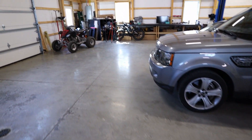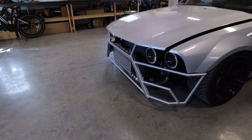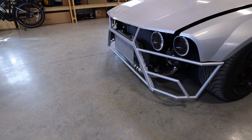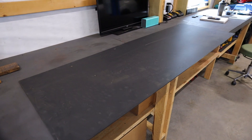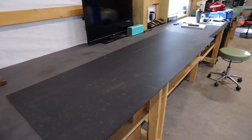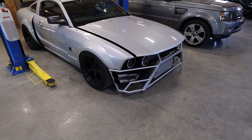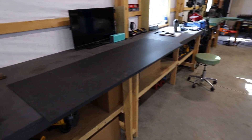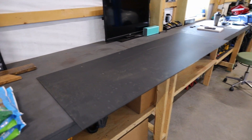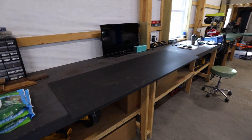The plan with the Mustang is to go straight to aluminum so we don't have any issues. I'm thinking I'll use 3/16-inch thick aluminum most likely — quarter-inch was a little much, and that way we can keep the weight down a little bit. But for today I have some extra kydex material here, which will be a good way to mock it up and get a feel for what it's going to look like since it's already black. I'll cut this and set it down below the bumper. It's not quite wide enough, so I'll just mock up one side and that'll give me a good enough idea. First up, I'll start to mark and cut this.